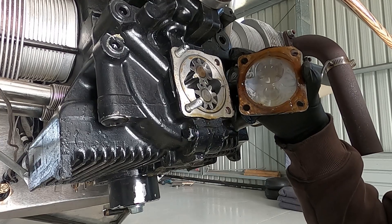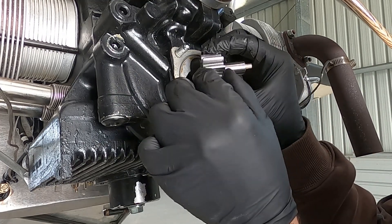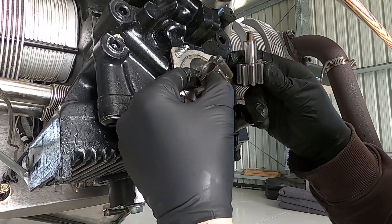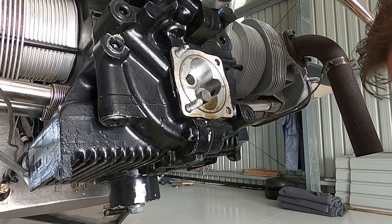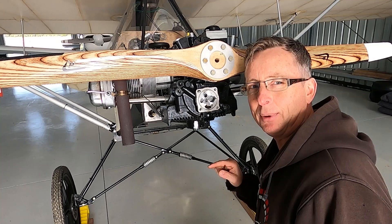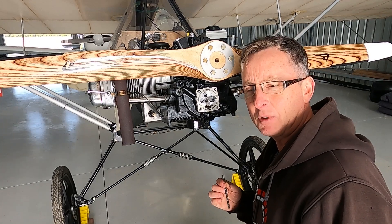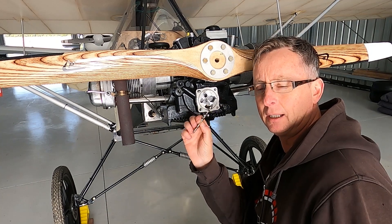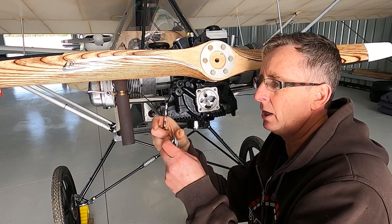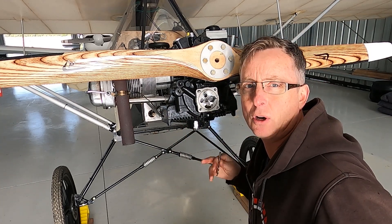That's the inside of my oil pump. I now need to extract it from the block. I'll pull the gears out — there's the first gear that goes into the back of the cam, and this is the second, just the idler gear. The gears are off, but I was hoping I could just pull it out of the block — no such luck. I don't have the extraction tool, which I can see you can buy online, so I'm going to make something up from scrap. I've got a drill bit and some chain with a carabiner.